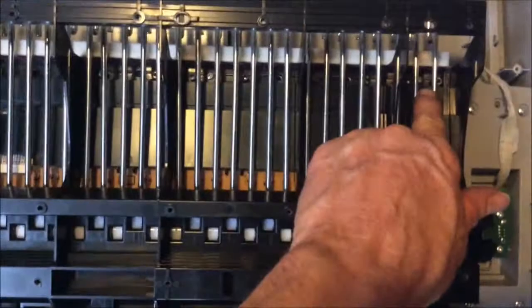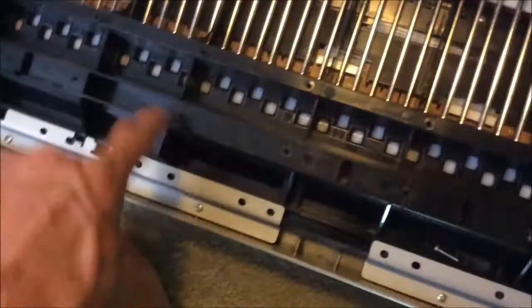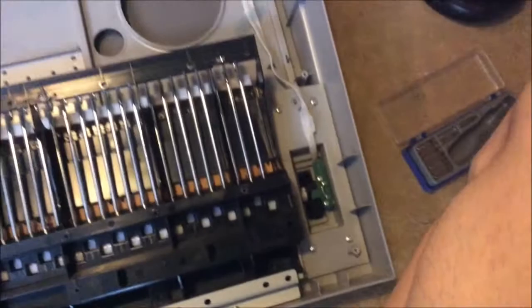To quickly summarize disassembly: you've got eight screws along here, then one, two, three, four — take the strip off, repeat for the next strip, and again for the third. You've got your ribbon cable over here, and three screws across here and three across here. Once all that's undone, it lifts out. Be really careful — if you drop it or lean it on the keys, the keys will crack the sound boards. That's what caused the original damage: somebody dropped something on the keys and cracked the three sound boards.